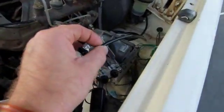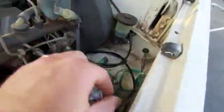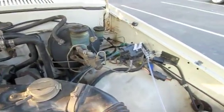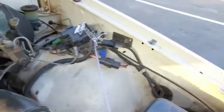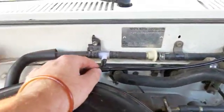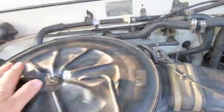I have some different hose on here — this is just regular aquarium tubing. And I have some other hose on here because the vacuum wanted to collapse the hose; it wanted to collapse this stuff. So I have it routed into my brake booster area, just in front of the check valve, and that flows right down in under the carburetor.